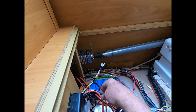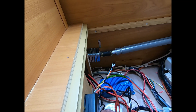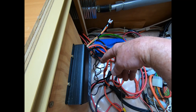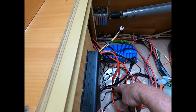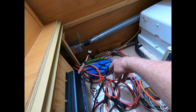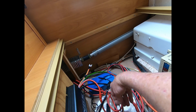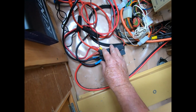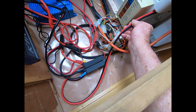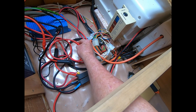I've taped up the wires I didn't need and made a T-joint for the neutrals to make it easier. I didn't connect the temperature sensor wire as I don't need it at the moment. I put 50-amp fuses on each line. The connection box isn't a real tidy one but I've upgraded the wiring to the battery — it had a tiny skinny cable before, so it's now eight-gauge throughout. Everything is done in eight-gauge with solid joints and high-link compression joints.